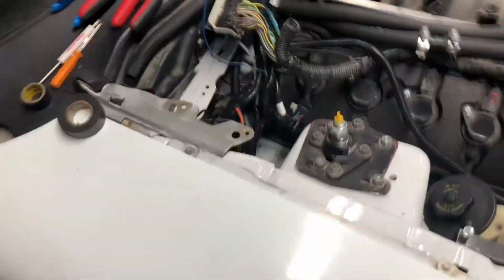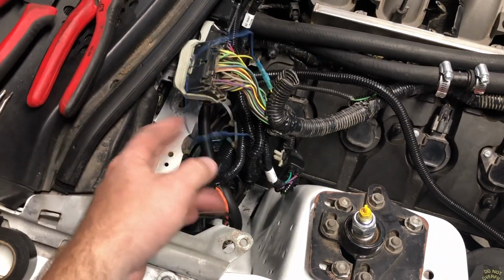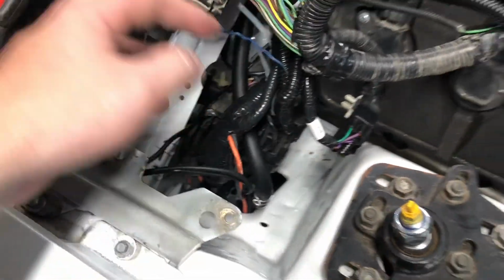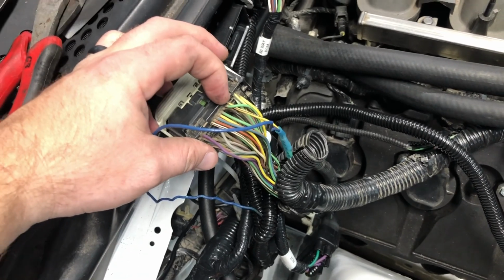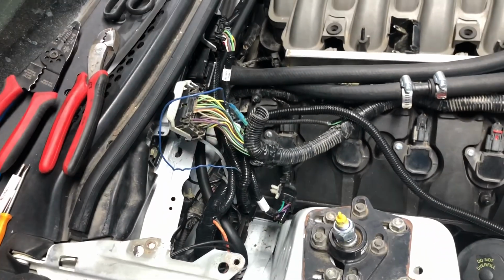That guy's coming. Tack. The blue wire from the stock wiring harness that went to the crank signal sensor, plugged into my 42 pin dealie down here, is going to tee into the middle plug for the engine harness here, yellow and purple on pin 13. This is a Gen 1 control pack with a truck harness. You just tee that in there.